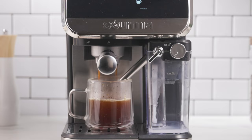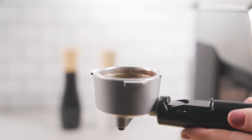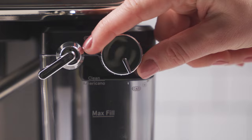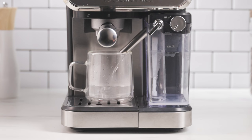How to clean the Espresso Maker. Remove the portafilter from the brew head by rotating it to the left. Lift the filter retention clip over the filter edge and dump the remaining grinds. To clean the espresso maker, position the portafilter and milk reservoir into place. Turn the froth strength control knob to the clean position. Place a mug on the drip tray and tap clean.